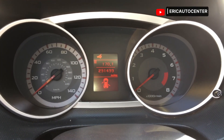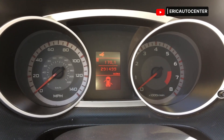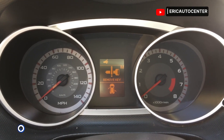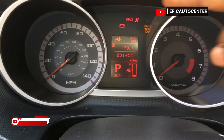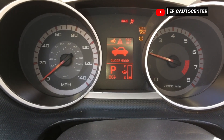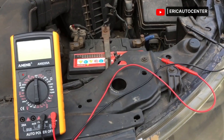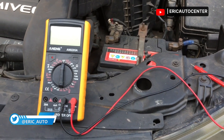First thing we all know is that as soon as you start up your engine, the battery light or indicator has to show up on the screen to show you whether it is charging or the system is good. You first have to turn your key on to see the battery light — this is the battery light — then you start the engine. As soon as I start the engine, the battery light is off, which means my charging system is working and the battery is charging.